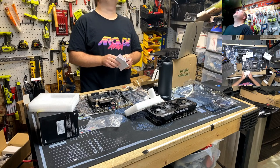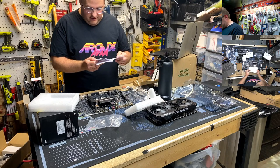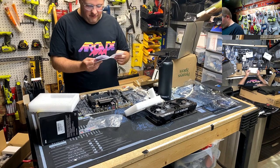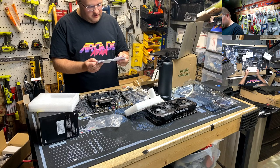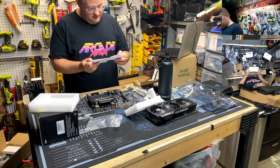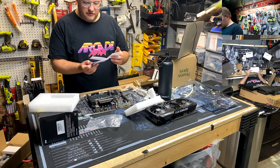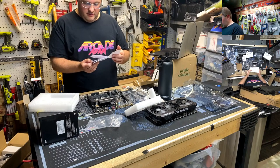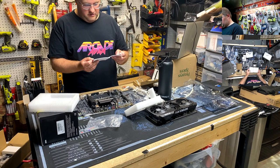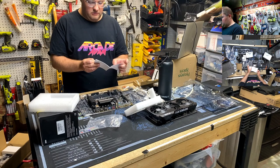The electronic version of Rachel Ray. That's awesome. Okay, we've got spacers E, F, and G. Take your bets amongst yourselves which ones are the right ones. Intel, you use the E spacers and the H screws. How the hell do you know it's H? Oh, the shorter ones. So you use the little guy spacers and the small screws for, like, that's LGA 1150, oh, LGA 1200.